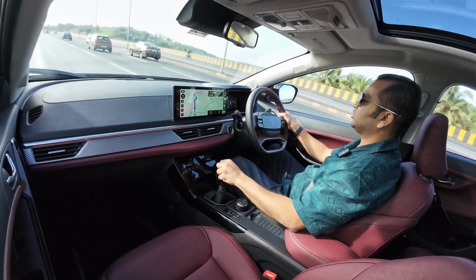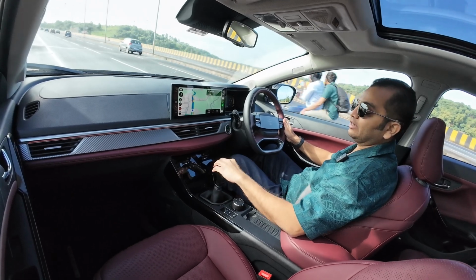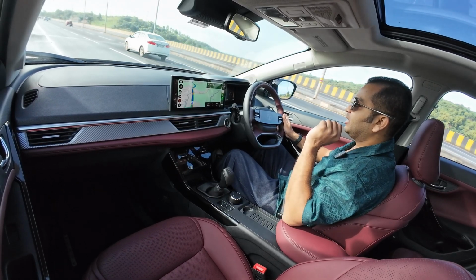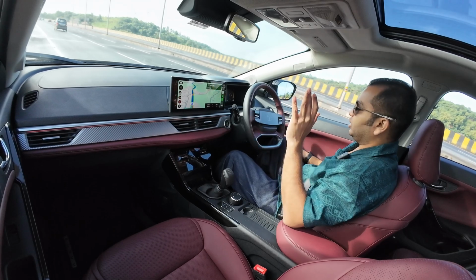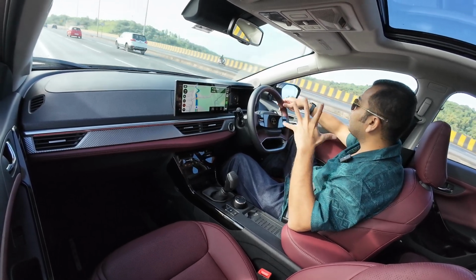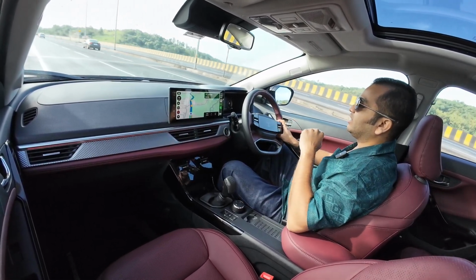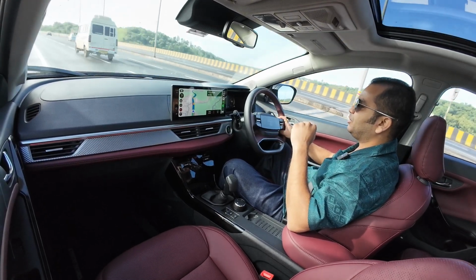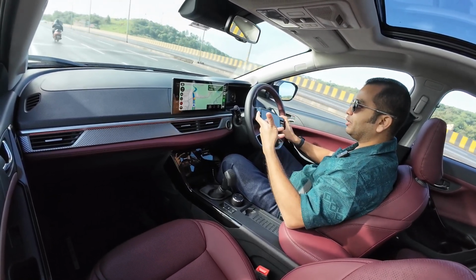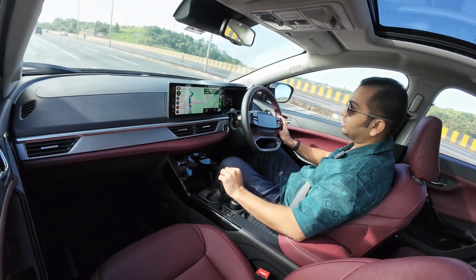And this time, when I come to a standstill, I am going to now slot this vehicle in second gear. Again, EPB is off, auto hold is off, and check this out. I am simply slipping the clutch, modulating the clutch only. Right foot up, no throttle input. Check this out. No knocking, no audible hesitation, and I have both my feet off now, not touching the ABC pedals at all, and the vehicle is crawling at 17-16 kmph. And now when I tap the throttle, it has started to pick up, and all of this while we are on an incline patch.